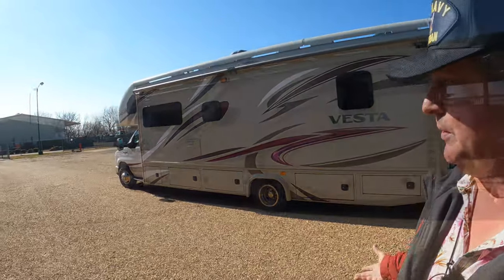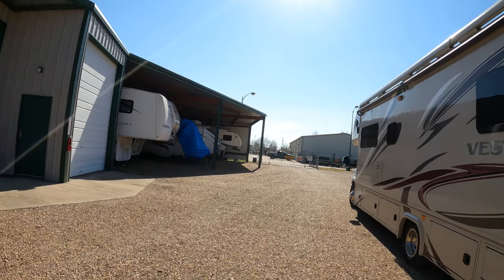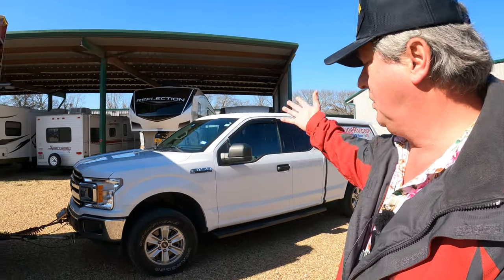When you're asking the question of how to tow an F-150, you've got to know that it requires a formula and the right setup. In this video, I'm going to show you my setup. It starts with the numbers. My Class C motorhome weighs just a hair over 16,000 pounds, and I can pull just under 7,000 pounds. I know that by looking at the combined vehicle weight rating numbers and subtracting the weight of the motorhome from the gross combined vehicle weight rating, which leaves me with 6,800 pounds that I can tow.